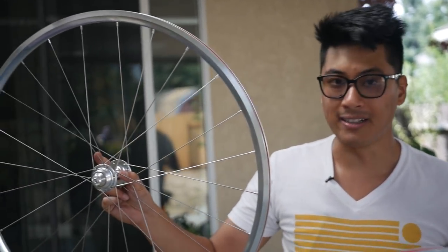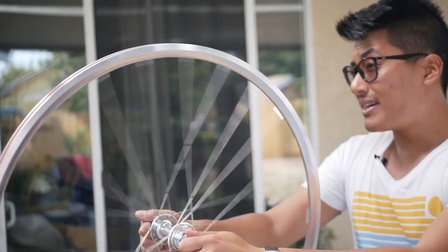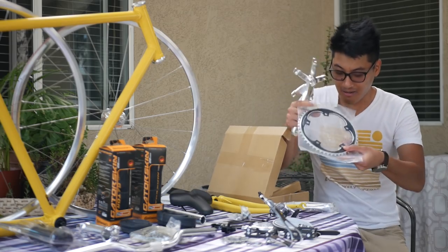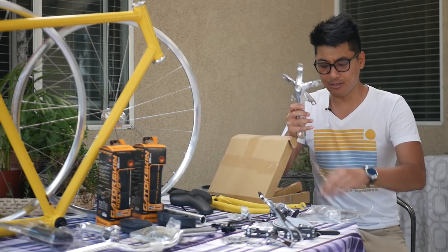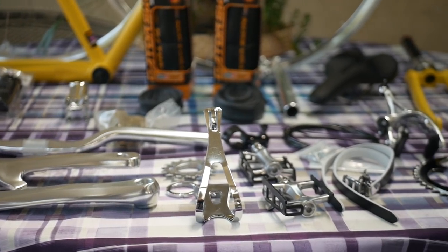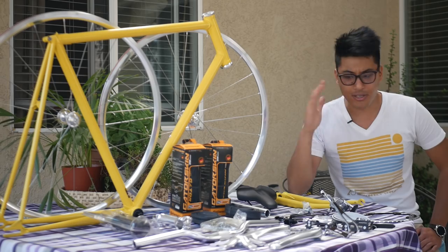These wheels are 20-spoke for the front and 24-spoke for the rear. It might sound light on the spokes, but what Wabi does is they have these wheels machine built and then hand tension them so they're perfectly true — probably about one millimeter out of true, but pretty near perfectly true right out of the box. And lastly, here are the cranks and chain ring. They're Andel track cranks, 144 BCD. I highly recommend these if you're on a budget — they ride just about as well as my 75s. Here are all the components. It's not a standard Wabi Retro; I do have some upgrades — the Wabi Sub-15 wheels, which are lighter, and some Continental Gator Skins.